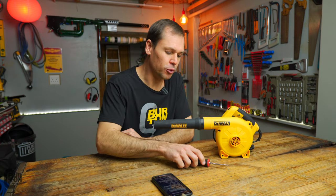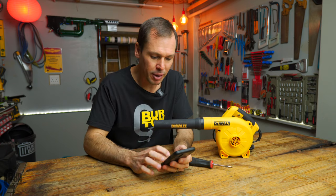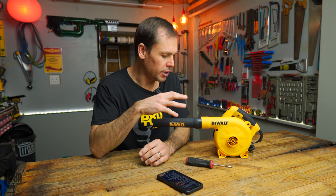This is a pretty simple procedure that basically anybody can do. You don't need a mountain of tools — all you need is a small flat screwdriver and of course a new set of brushes. A quick Google search brought up DeWalt brush pair N437939 as the part number. They were around five pounds, which is roughly seven dollars or about 100 rand in South Africa at the time of filming. Small as these parts may seem, they are quite important to the continued functioning of your tool.